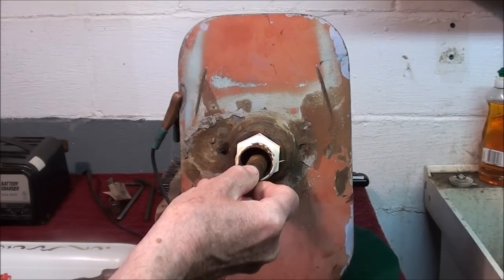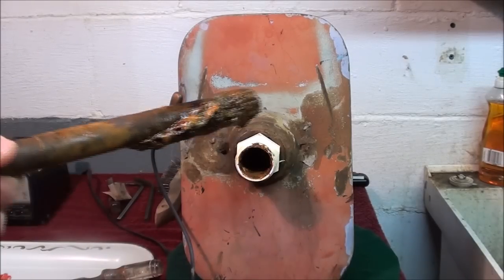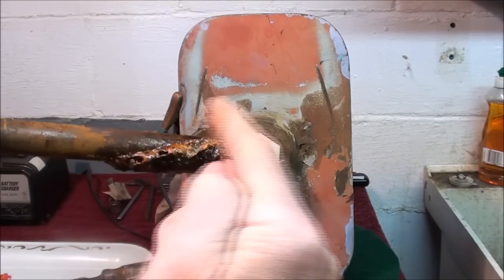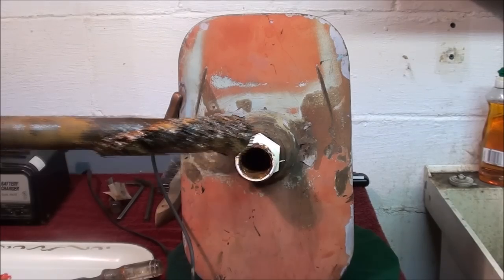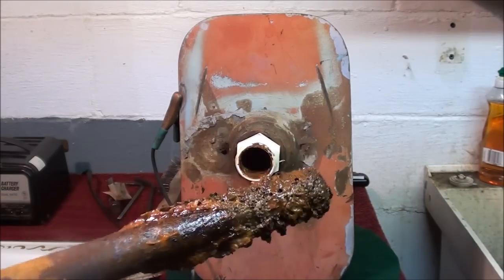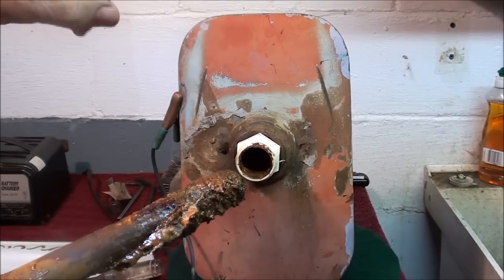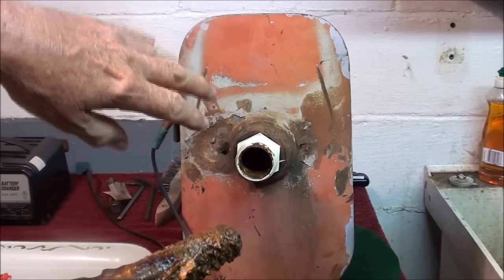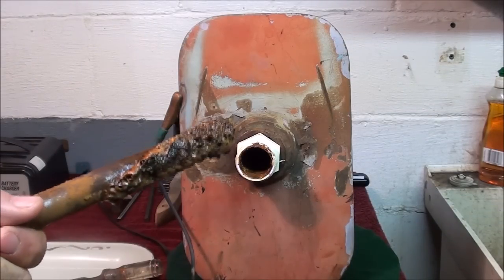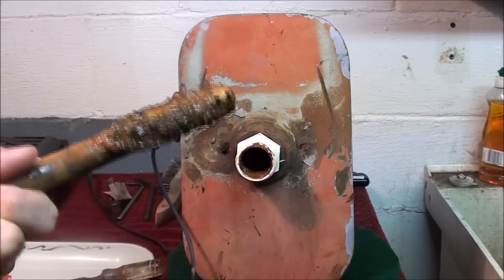Pull this out and see how much accumulated over the night. But the water level has greatly decreased because of the leak I've got now — you can see that's where the water level is. I really need an electrode with a bend on it that'll go way down in there. The more electrodes the better, but there isn't room to get them in this little hole. So I just got one, but that's what we got overnight. I'm going to rotate this 90 degrees and do this for a couple days, rotate it another 90, and so on until I've got the full 360. I'll scrape that off now.